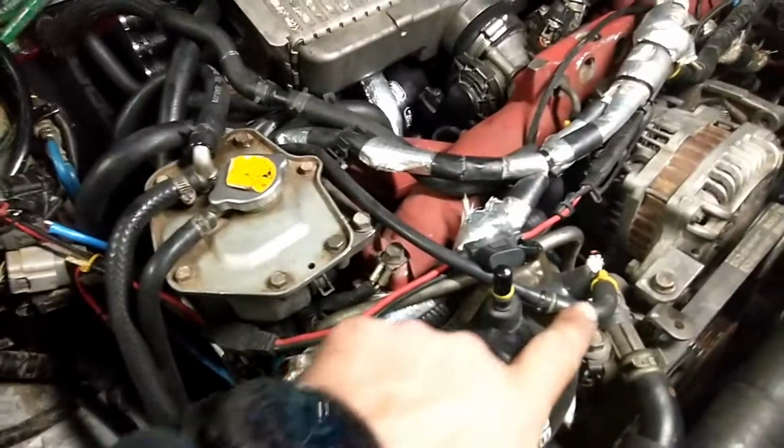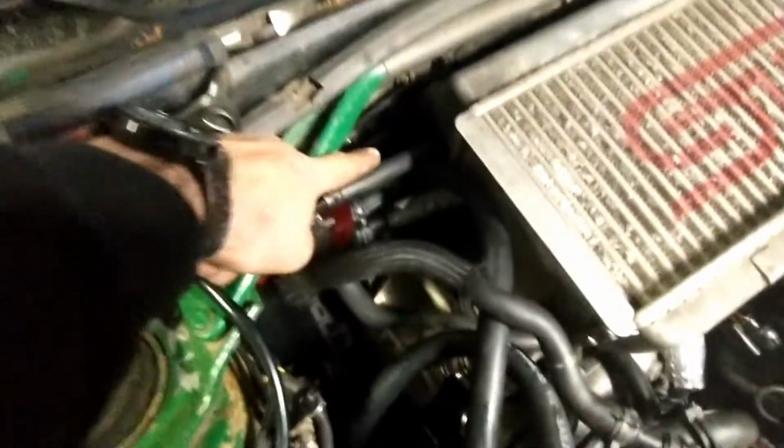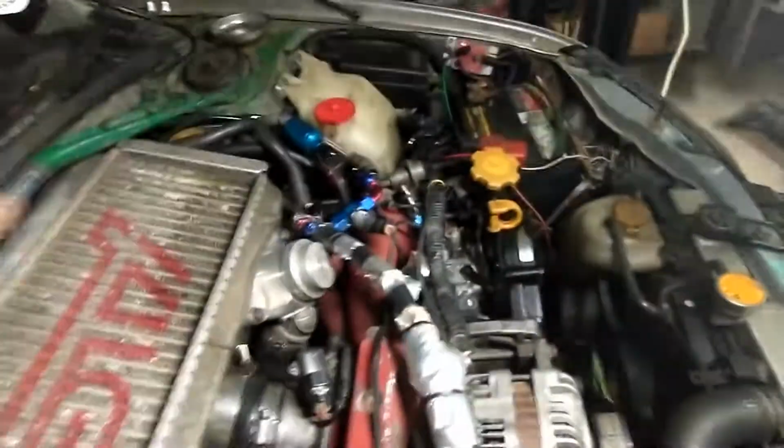We have a completed install here. So the upper coolant hose, lower hose, put it here. And here are vacuum lines: here to the left, and the other one from the back of the inlet hose to the right. This is going to under the throttle body. Here, passenger side PCV. The middle one goes on the other side, back behind the intercooler, driver side PCV.